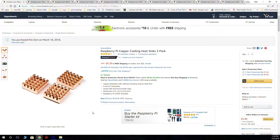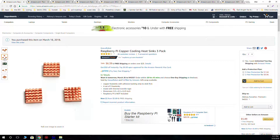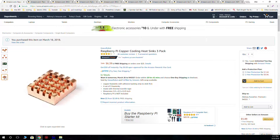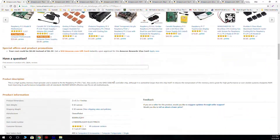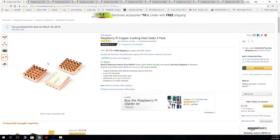One of the first things you're going to need for this graphics card — since we're going to be taking away some of the cooling for the VRM and some of the other components that are typically cooled by one of the plates attached to the front of the card — you're going to need to get some of these coolers. They don't have to be this specific brand or anything, but typically any copper VGA heatsink is going to work. What I haven't included in this video is that you also need some adhesive tape, because the sticky stuff at the back of these is kind of crap. You can look for thermally conductive adhesive tape, which will make it a lot easier to keep these stuck on, because since the card is upside down, over time they'll actually fall off. That's really frustrating — I've had it happen to me a bunch of times. One of them actually got lodged inside one of the fans from my power supply and made the fan stop.